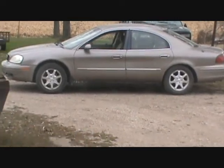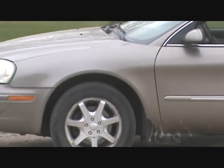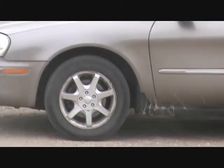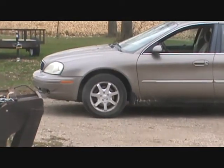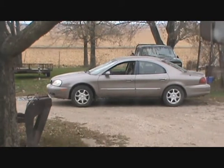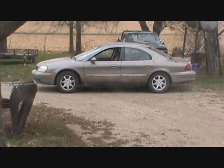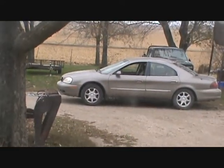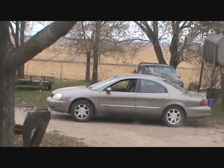Sorry guys, I got going and I got it together, and all I can say is it drives nice. Look at how much clearance is around the wheel wells now in the front, now that I got the new struts in. Before, there was not that kind of clearance. So on this car, putting new struts on, it almost looks like it needs a back driver's side strut, but it rides good. Wish it wasn't so windy. Front wheels are straight up and down now. They're not tilted. So I guess it needed it.